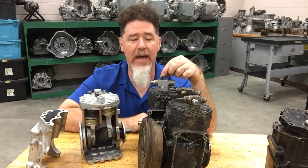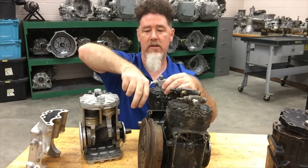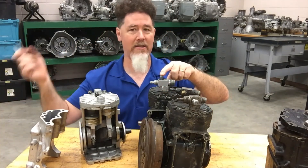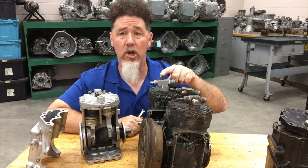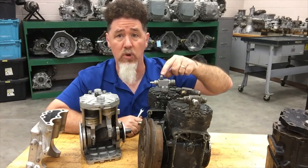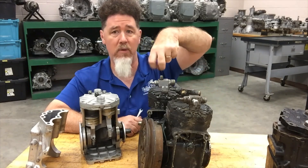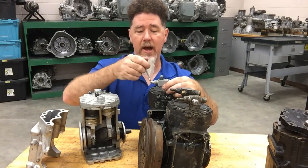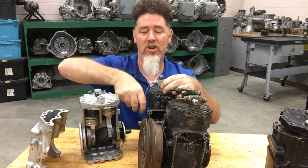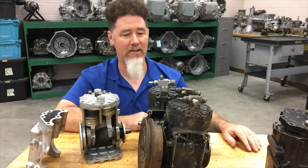Another mistake that students make is they have their gauges hooked up doing diagnostics. If I'm doing diagnostics, I'll put it back in the mid seated position. When I'm done and ready to take my gauges off — whether it's originally R12 or retrofitted to 134A with a separate adapter for quick connects — you've got to make sure you put this back to the original back seated position. Because if you don't and you unhook your gauges, you've just lost all your refrigerant and now you have to recharge it all over again.